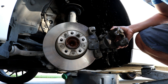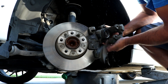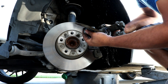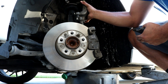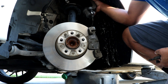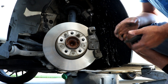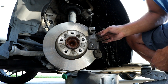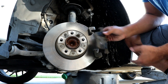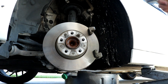If the reservoir overflows, you need to put a drain pan or something under the car to catch the fluid. Once the piston compresses back in, pull on this pad right here and it'll just come right out. Then just hang the caliper on by the spring up top and leave it up there. Then go ahead and pull out the other pad just like so, and then grab your new pads and slide them into place.